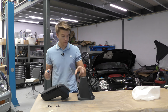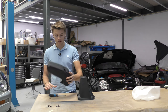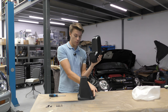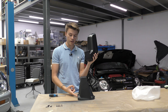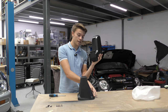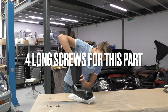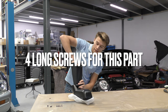We're going to start by adding the top half to the main piece before we get in the car, because that's the last piece. There are four screw holes on the bottom and four screw holes here. The curved piece and the rounded piece will tell you back to front — the curved side faces the front of the car towards the handbrake, and the rounded side faces the rear seats. If you've got a longer screwdriver than this it would probably help you massively.